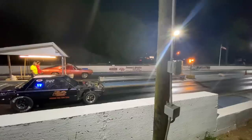All right, so there's an event going on, so I'll take a back seat for about 20 minutes or so. Let them finish up, and then they're gonna call us back in, and we'll try the Transbrake. But no matter what I do, the 1.7, the 1.8 60s are pretty consistent for a 119 mile an hour at about a 6.5 to the eighth without using Transbrake or a two-step. So pretty cool. No matter what track I go to, we're running about the same times. It's definitely a backup car for sure. This thing loves the quarter mile.